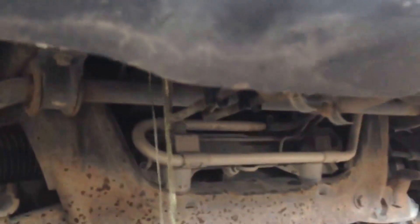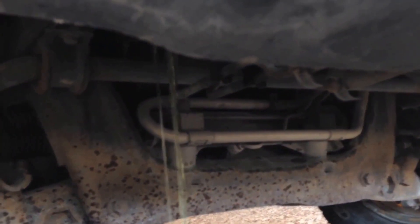I'm going to bite to eat — a bit of corned beef wrap and some nice water and a cup of coffee. This is a 2003 Ford Ranger and the timing guide went on it. It's a pain to change. I can't really see the guide but it's down there. And this is the damage that did to the top of the valve — right there.